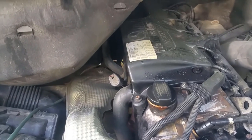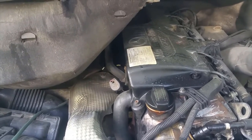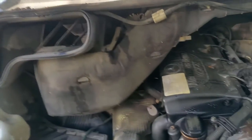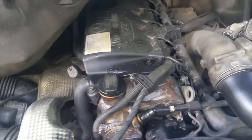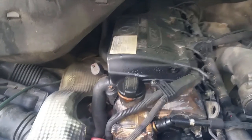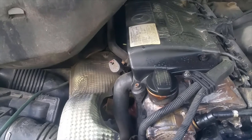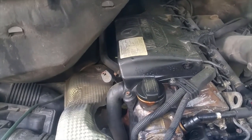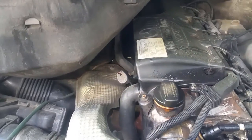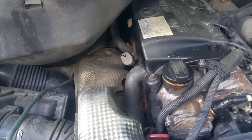You check your transmission fluid with the engine on, not off. Before you start your engine, twist your key forward and start shifting through all the gears - first, second, third, neutral, drive - shift through all of them. Then start your engine and shift through every single one again. Come back and add whatever more fluid you need. If you added six quarts, you'll probably need another two to two and a half quarts, because the solenoids start pumping and the torque converter needs to get all its oil.